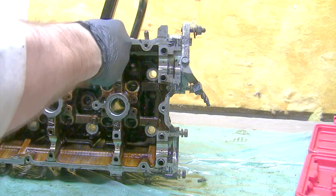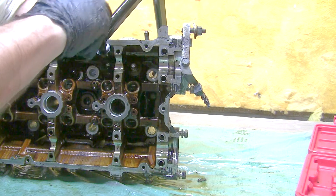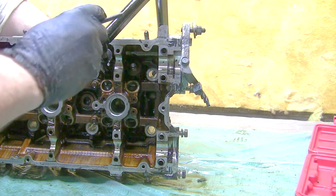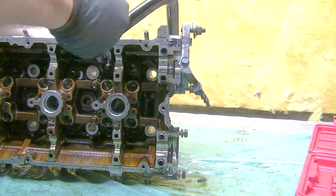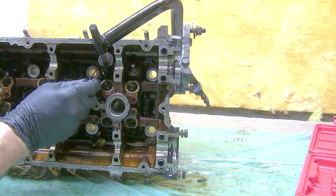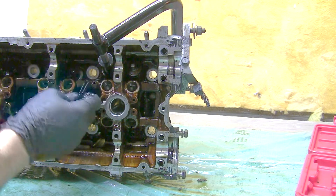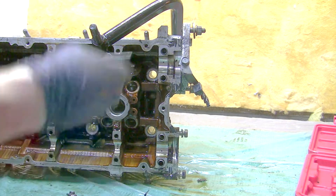Now we'll go ahead and actually show the full operation from beginning to end. You need to put the clamp on and line it up so that the back side of the clamp is pushing on the bottom of the valve, then tighten up the top side on the spring retainer so it's held in place. Once it's being held in place, use the handle provided to crank down and put pressure on the spring to loosen up those little retainer clips. Once the spring is compressed enough, use a pair of needle nose pliers to get in there and remove the small retaining clips. I'd suggest using a magnet - I think it would work much better than pliers but I didn't have one. Make sure you've got a small magnet handy as it'll make it a lot easier to take those little parts out.